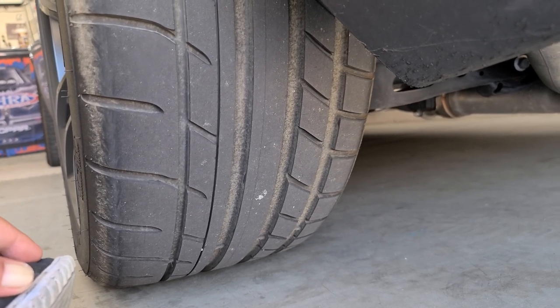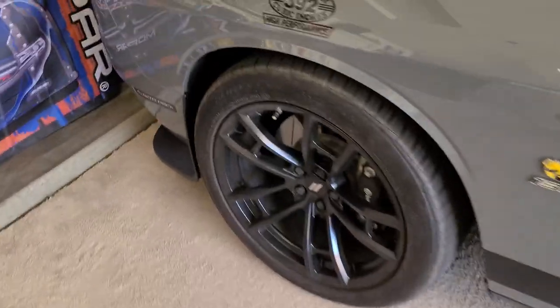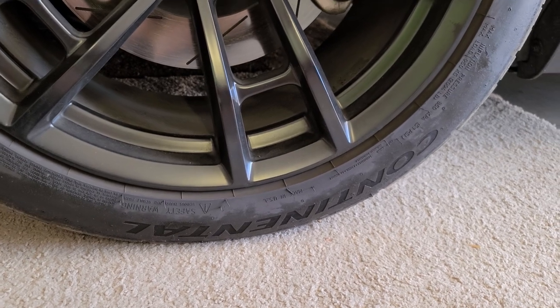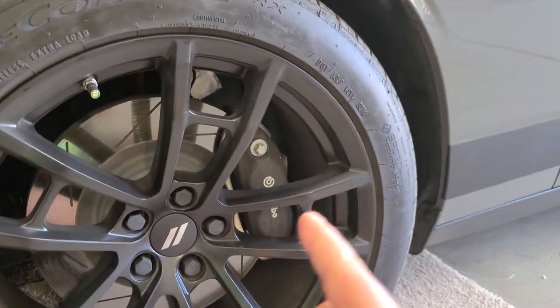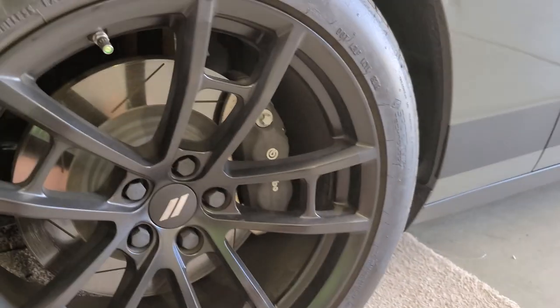I thought this would be amazing, but I have to be honest — they're really not. As you can see by the intro, they spun into second gear. They won't even take a soft launch off the line; if you touch drag mode, you might as well just have ice skates. Now the Continentals are a thousand times better from a traction perspective, which is strange because they have a similar tread pattern but with sipes instead of blocks. I'm not sure why they're so different. It may be that the compound on these tires is actually softer or better for street use than the Mickey Thompsons, which would be surprising, but stranger things have happened.